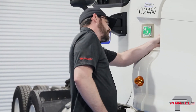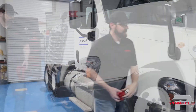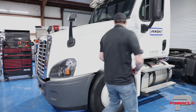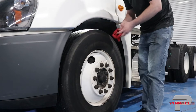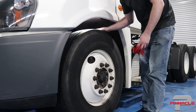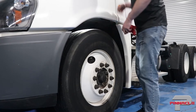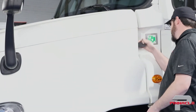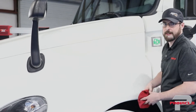I'll go ahead and unlatch the hood and move around to the other side. Over here on the left side we're going to do the same thing — clear the tire off and give it a feel. I don't feel any feathering or tapering; this tire feels okay. Now I'll undo this hood latch, open the hood, and take a closer look at some of the steering components on this truck.